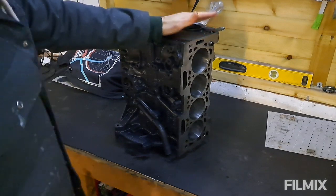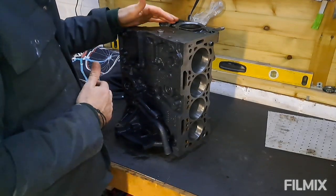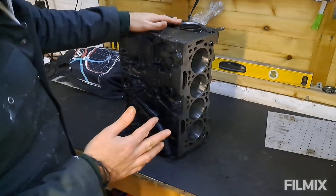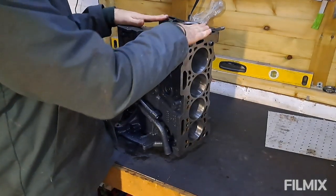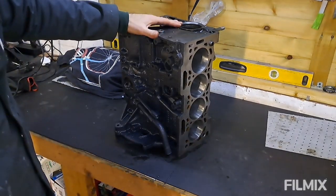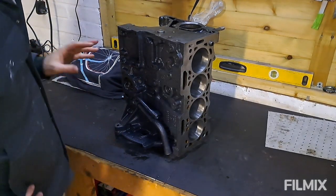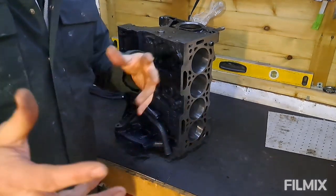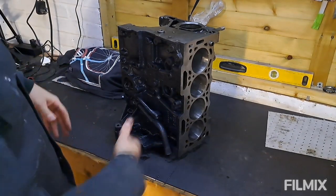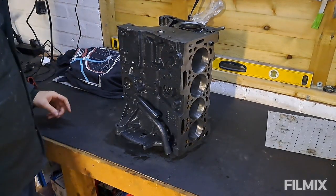The next steps for me are to get this through the wash — I just want to make sure there's nothing in there that shouldn't be, just for my own peace of mind. I'll stick it through my parts washer, get through all the galleries and give it a good clean. Then I'll give it a good dose of WD-40 everywhere so it doesn't rust on the external bits, put some build oil on the cylinder bores and on all the bearing faces so they don't start to rust. Then I'll start cleaning this down ready for paint on the external faces, and once we've painted we can start putting some of the fancy bits on that have already been refurbed — alternator setup, bracketry, engine mount brackets — quick wins, dead easy, will look good straight away.